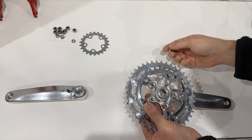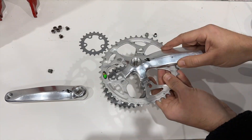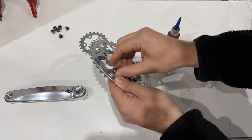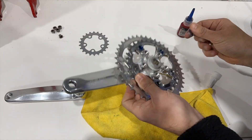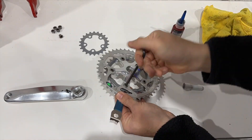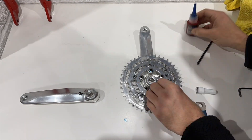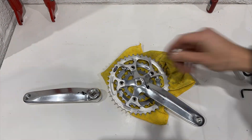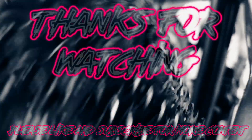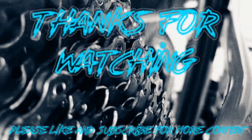The final job in this video is reassembling the chainset. It's actually a bit of a fiddly job because the inner arm on the spider is kind of behind the crank arm — it uses a shorter chainring bolt that you have to put through backwards. It was a bit of a fiddle but I got there in the end. I overdid the Loctite because the bottle is on its last leg and squirting everywhere, blowing loads out with every little puff. Thanks for watching, and I'll see you in the next video where there might be a few surprises in store for this bike — join me then!